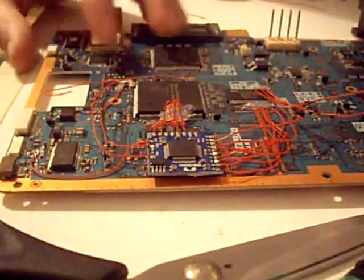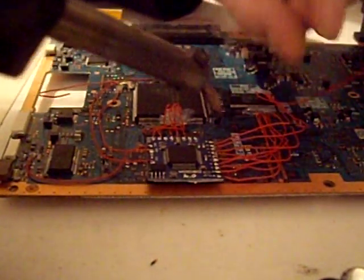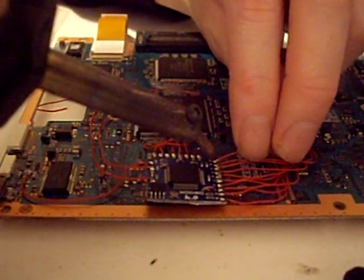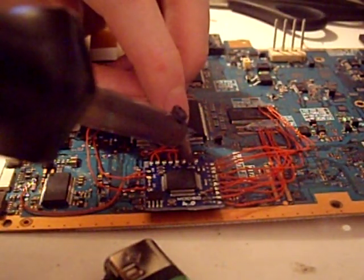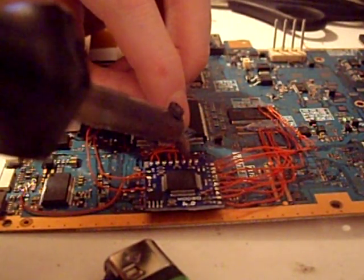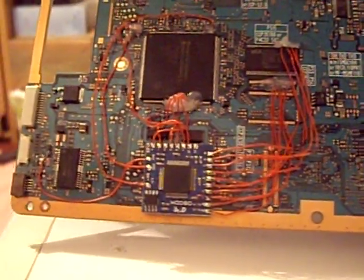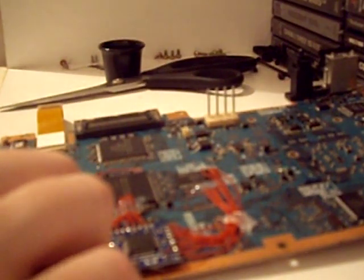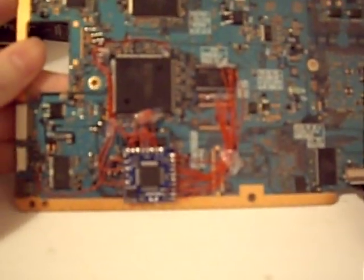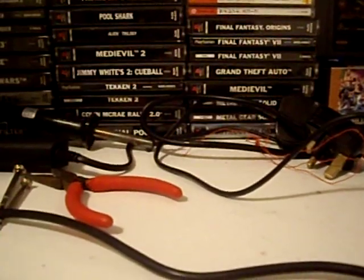So that's O in, N in, and that's M in. So that's our section — all our points are soldered in now, very very tricky. Let's tidy it up with some glue. So that's our finished install with glue on, tidied up. Next step is just testing, so that's it for part one. If you enjoyed this video please rate and subscribe, and join us in part two when we reassemble and test the console. Bye everybody!